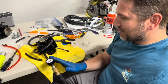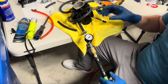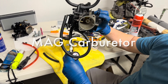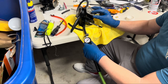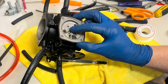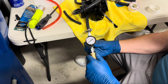So we're gonna do a pop-off pressure test. I have this little apparatus that I've created to do that. We want a pop-off pressure test of 25 psi. Basically you seal everything off with a bunch of hoses and then take this — you want air to pop off right here. It comes out like this, where you give it gas, this thing opens up. So you want this to open up at 25 psi. We're gonna open this up and see if it pops at 25 psi. Here we go.